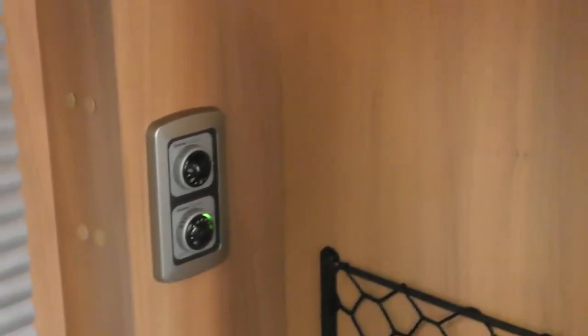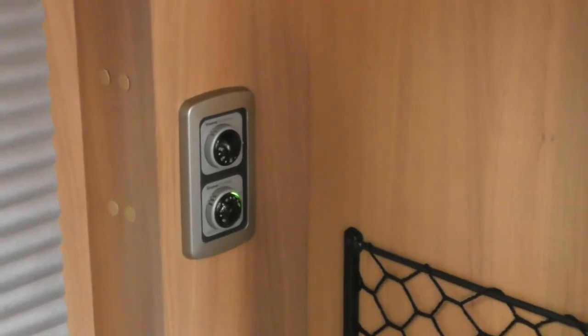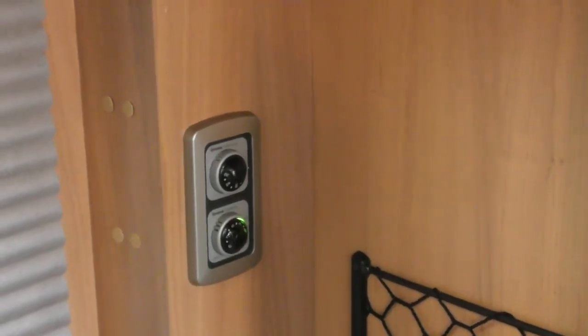So it's a bit like old Granny May's electric bar fire. Imagine 500's one element, 1,000's two elements, and 2,000's four elements going at the same time. So the more power you send, the faster it'll heat up for you. And then your thermostat is the black one on the outside. 9 is the hottest, down to 1, which is the lowest. Is 1 just frost? Yeah, 1's sort of like a low tick over, like an ambient.